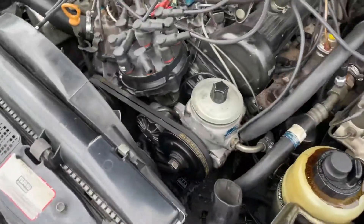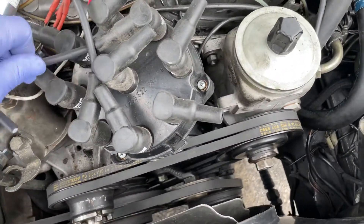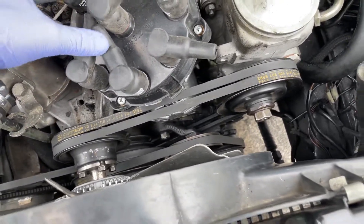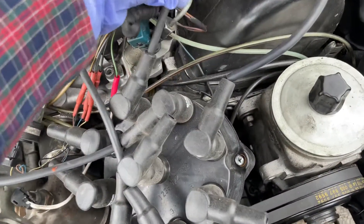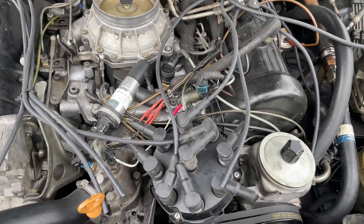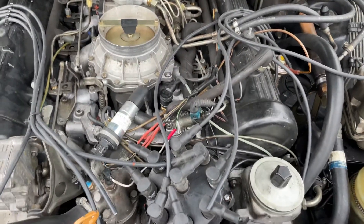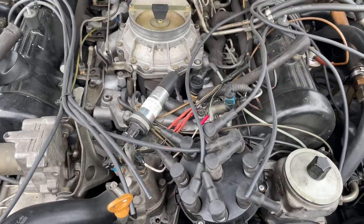Out of eight spark plug wires, I had six which were bad — the center one, and wires one through five. This one held up, and these ones are holding — you can pull on them. The bad ones were just stuffed in there. I'm going to change them and then we'll see if we get the car back running correctly. That's just a short update — check your spark plug wires.